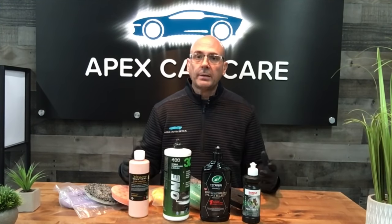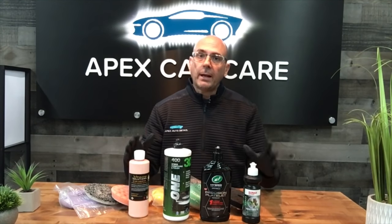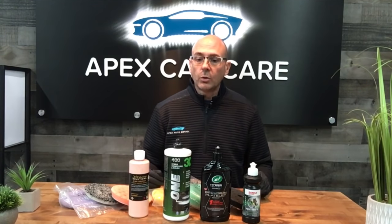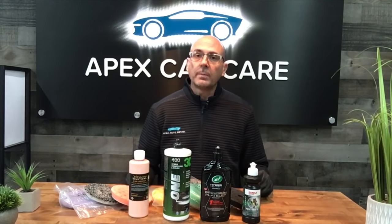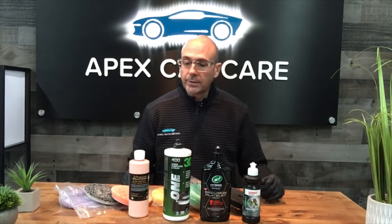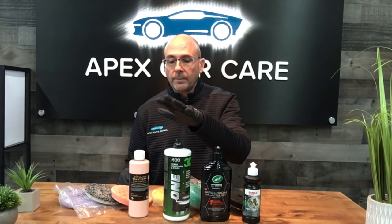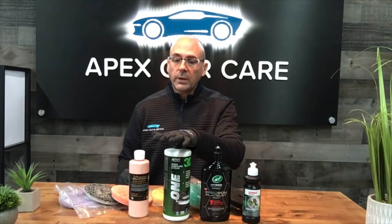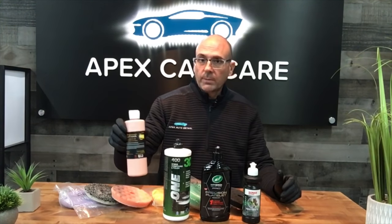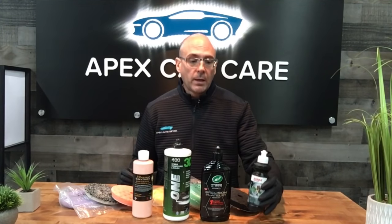This is a process that I really think it's important to get across to you guys to use on any type of vehicle 2018 and newer, just because of the softer water-based clear, and there's just not a lot of it on today's vehicles. Our go-to right now, the one and done from Turtle Wax, our longtime one-step 3D1 flawless cut from Extreme Solutions is great, and also Perfect Finish from Sonax.